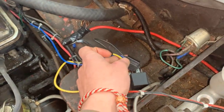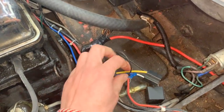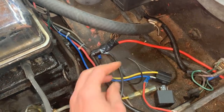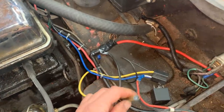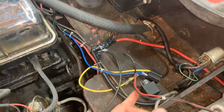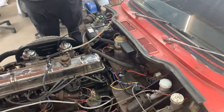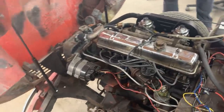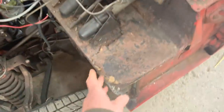I don't know why it is like this - the voltage regulator has been disconnected, and all the connections have been done to accommodate an alternator, which is probably why the wiring has been modified so much. There's a relay here which is disconnected. The blue and yellow wires are the switched part of the relay and the yellow one was going nowhere - disconnected. So this relay is useless. I have to decide whether to put it back this way or bring it back to stock and do the alternator modifications better.